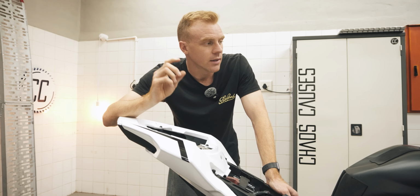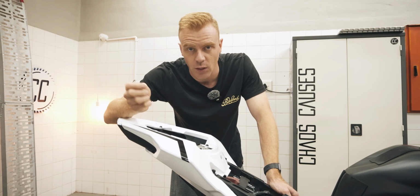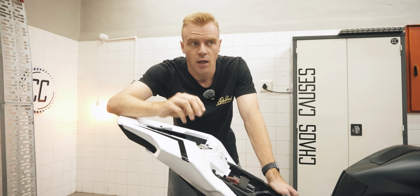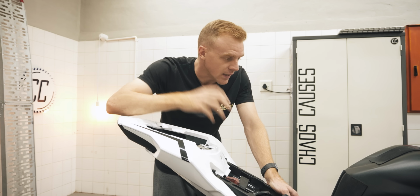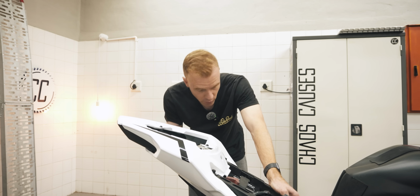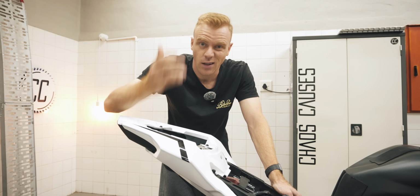And the whole way, the coolant sensor or the coolant temperature was going crazy. It would drop from about 50 degrees Celsius up to 130 degrees Celsius within like 2 seconds. Completely unrealistic. And the bike has new coolant in it. I know it is full, I know the reservoir is full, so it can't possibly actually be fluctuating like that.